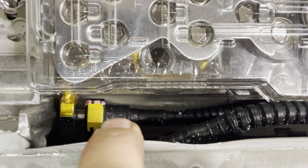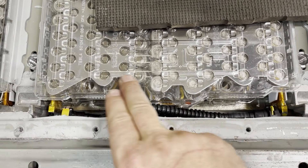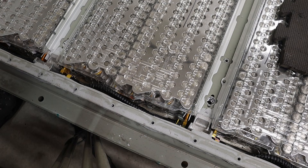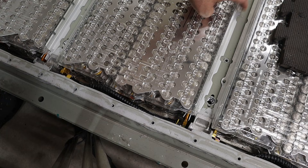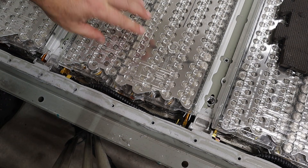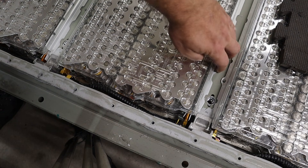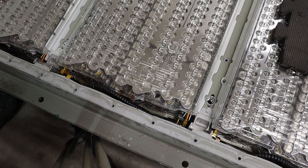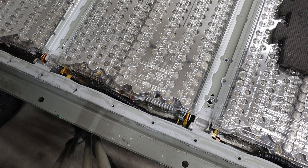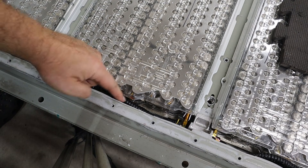The metal part of the hose is actually relatively long. Right now I can't get my hands in here — there's just no space — so I'm going to lift up on the battery module to get some room, and then unplug the coolant lines. There's a rail that sits down on top of this piece of metal, and that's the support for the whole battery module, one on each side. Under that plastic cover are the cells and their tiny fuse wires, so we don't want to be too rough. We need to pick this whole thing up using those rails. Down on the corner there might be a little caulk that needs to be cut with a razor knife, and then you need a pry bar to get under there and raise it up — maybe stick a block of wood in there — then unplug the coolant lines.